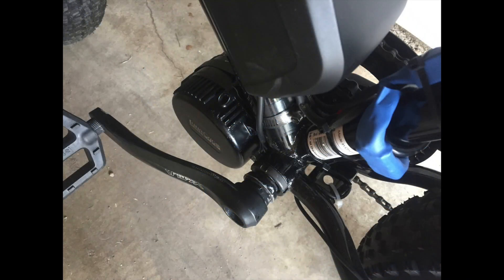The biggest headache in this whole build was finding a left crank arm that cleared the chain stay. I could not find one that had enough offset. I know Carl on electricbikeblog.com found one apparently pretty easily, but I looked and looked and could not find anything. What I did was butcher a different left crank arm and used the bottom part I cut off as a spacer.